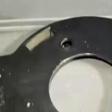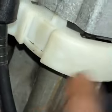To get it out, you're going to have to unclip that right there. This is like a little holder or something like that. And you're going to have to unclip it. It's 3 clips. One up top, one right here, one up top, and one on the other side. Just pop that out, and then the sensor will be exposed.